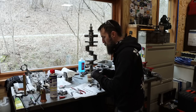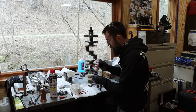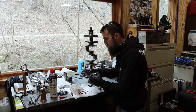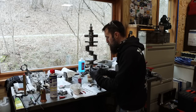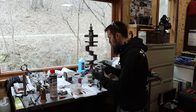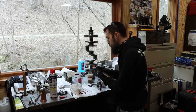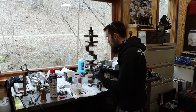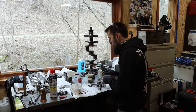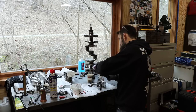So I've heard a lot of people talking about getting soft lifters and having trouble breaking in flat tappet camshafts recently, like they're getting a bad batch of lifters here in the States from several different cam manufacturers as well. It's not just one. So luckily, I am using a roller setup and hopefully won't run into any problems with my camshaft, but that would be a big concern for me right now if I was running a flat tappet setup. I would definitely try to use every trick in the book to make it last, because break-in is extremely critical with a flat tappet setup.